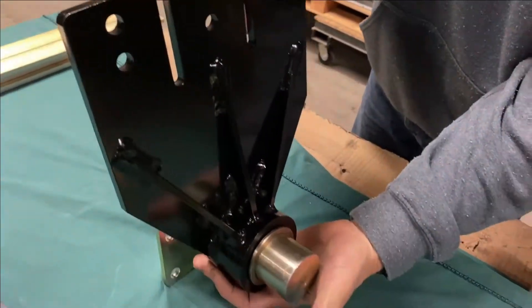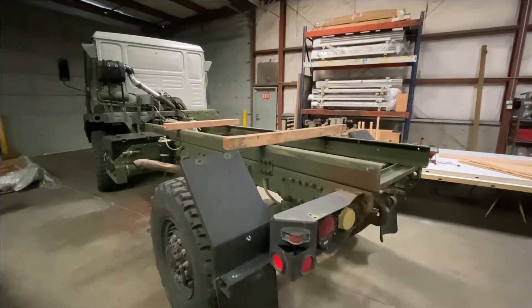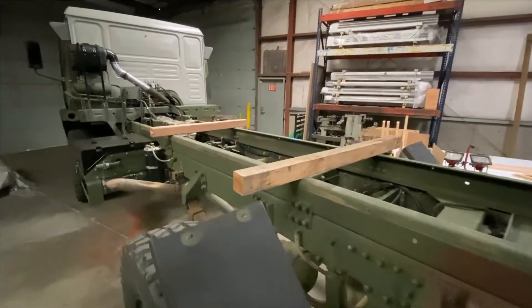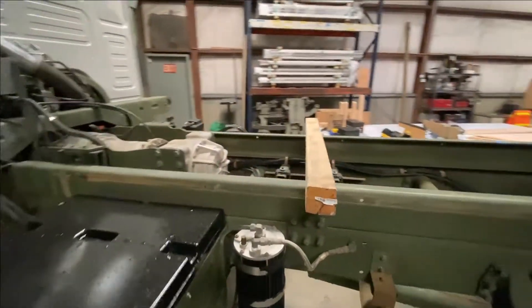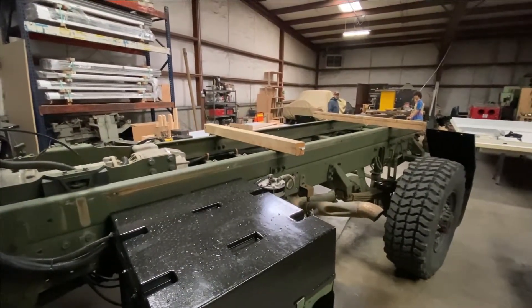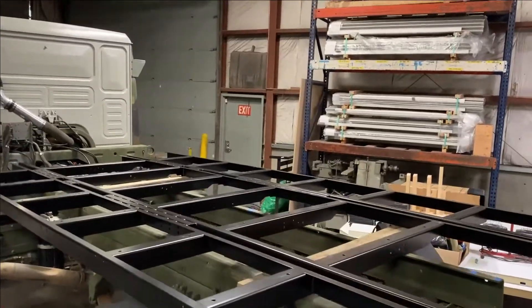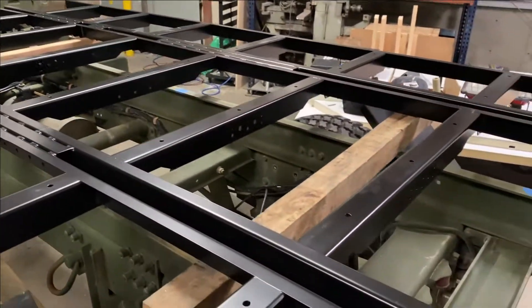You may download the terms of service from the website at www.rvglobetrekker.com. Keep in mind that many of the parts seen here will be fully assembled for your convenience. Prep the frame of the vehicle by placing at least two four-by-four posts that are long enough to span the frame. Use the posts as temporary shoring material to rest the subframe on for positioning and placement of the subframe brackets.